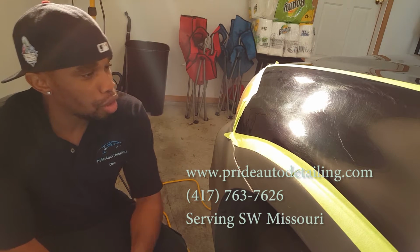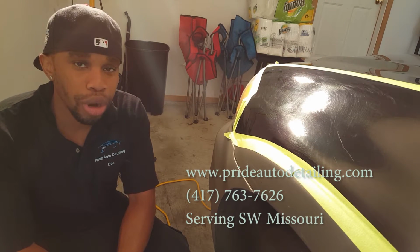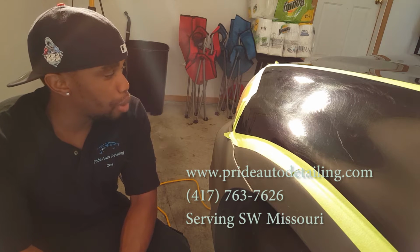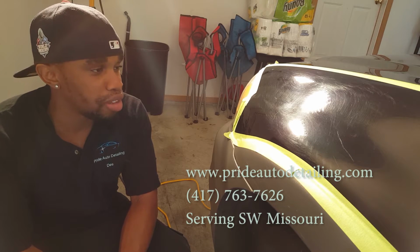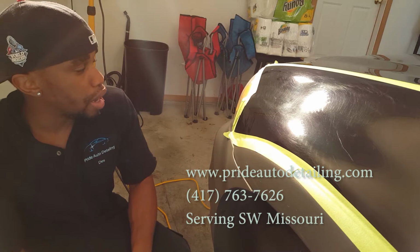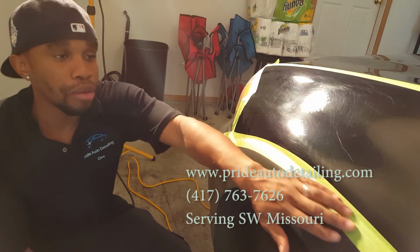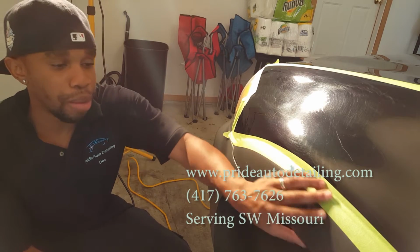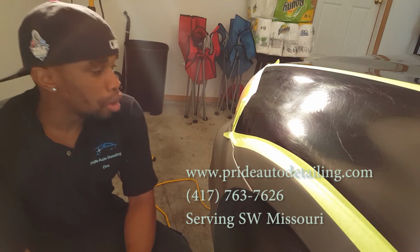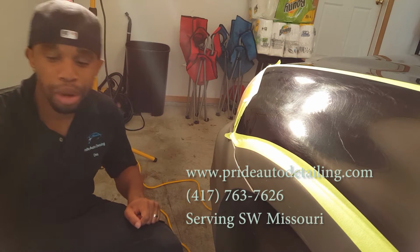Here we have a vehicle with obviously lots and lots of swirl marks. I'm going to show you what a difference just a one-step polish can make on this paint. The paint has already been fully prepped. That means it's been washed, it's been clayed to get off the surface contaminants, and it's been dried obviously, and also the edges here have been taped off so the buffer that I use doesn't damage the trim here and the seals here. So once that's done, you're going to need a dual action polisher.